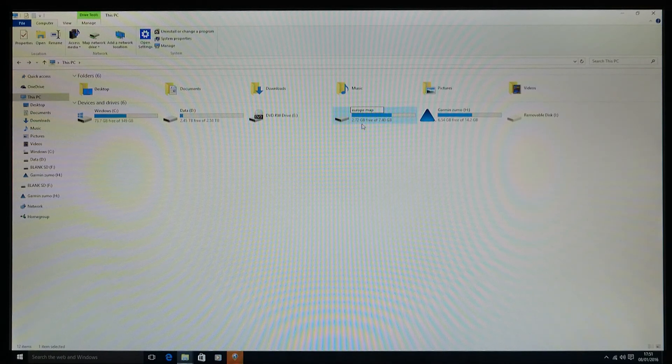Just as a final point: when you've done everything, turn your Zumo back on, press the volume button, press and hold the top-right of the screen until you get the diagnostics page up again, find MTP Settings, and turn it back to MTP auto mode. There's no need to stay in mass storage mode unless you're putting on another map. Just revert to the standard setting, and that's it. Have a good evening — cheers!